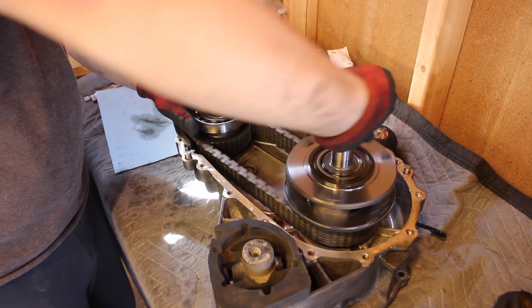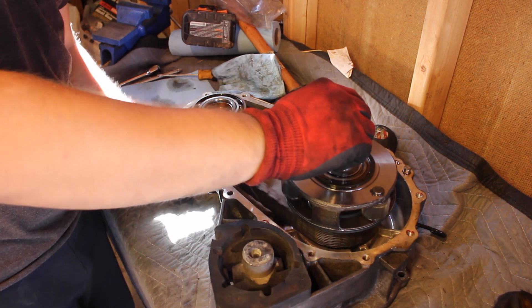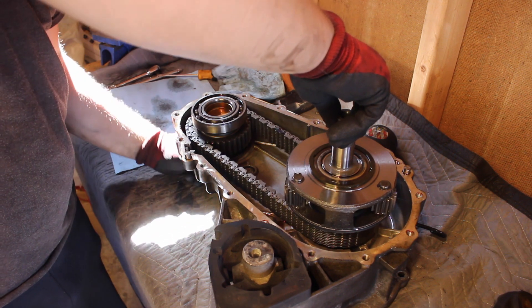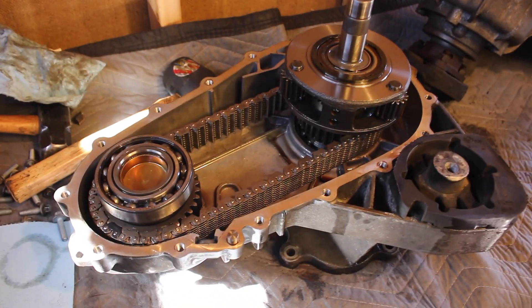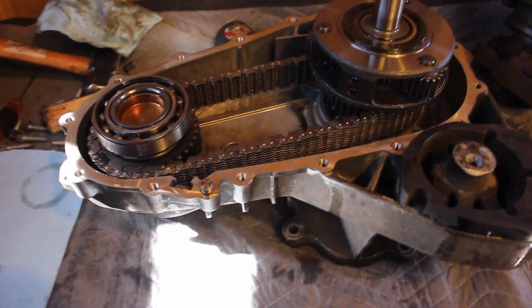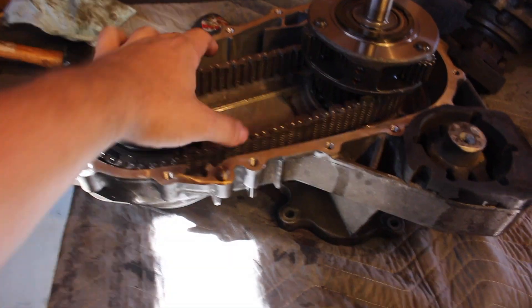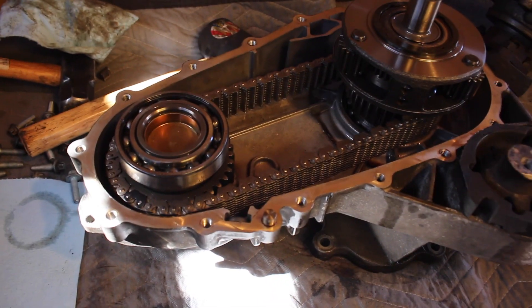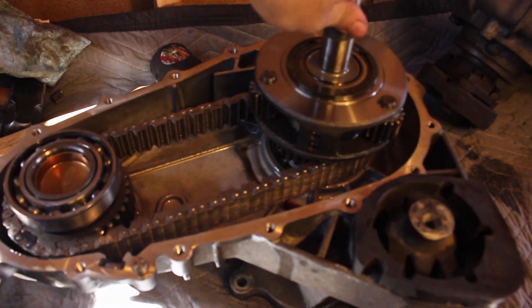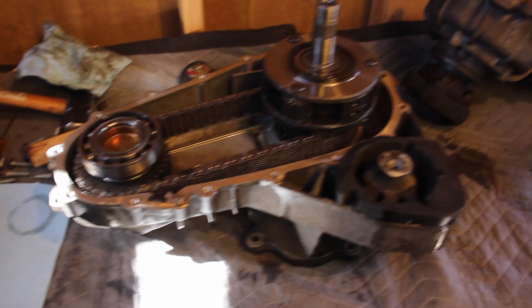If you hold one, this can spin independently, or it'll spin both. And the front one can spin on its own too — that's the beauty of this. Here's how everything looks put back together: you've got the planetary gears, you've got the new chain, a lot less play than before, a lot tighter. A couple millimeters makes a huge difference — it'll eliminate any of that play we had before. Everything's back together and functional, everything rotates. Which was surprisingly easy — I was expecting it to be a little more dramatic.